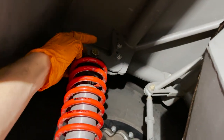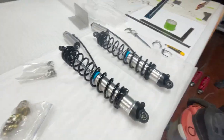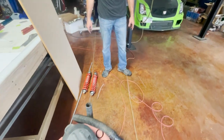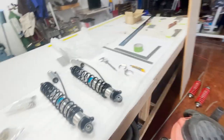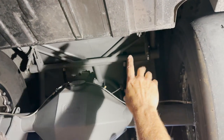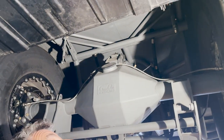We're going to reposition the upper bracket so we can get more like 50/50 on the shock and start there, give us a good base. The springs are 110 - about 10 less on these here, 50 less on the front. Those were double adjustable - a double Strange. I might put a single adjustable on there. The old ones are out and these need to go in, but we do need to come up with a place to mount the canister somewhere up under here. We need to make sure it's at full extension so we don't end up ripping the tube out. Wherever it can mount - can't be down in here because we can't get to it with the fuel cell.